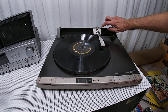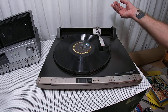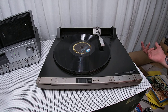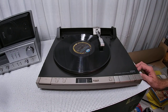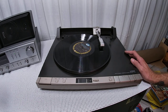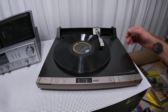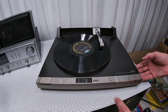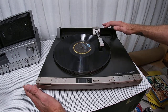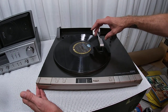This one is plastic right here and plastic here. They look good and they work fine, they're just plastic, and I was not impressed by that. Then again, the counterweight is extremely easy to operate — on the Yamahas, Pioneers, Technics and those types, once you get to their higher end they're easy too, but this one made it stupid easy, so kudos to Luxman for that. The guide wire is in great condition. Maintaining this thing is silly easy compared to some of the others — just taking the top off, the whole mechanism comes up so you can service it.